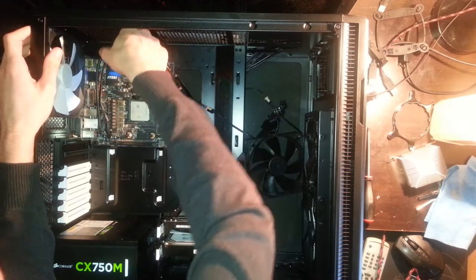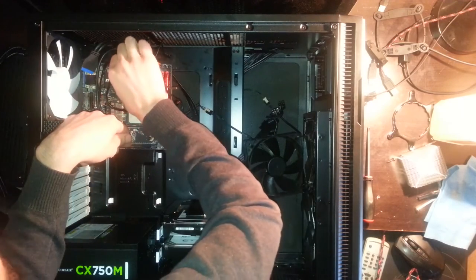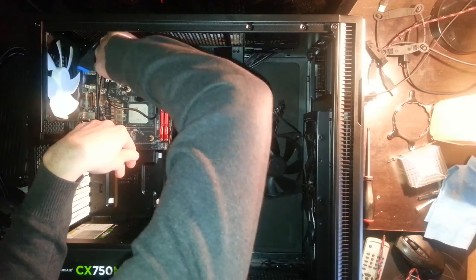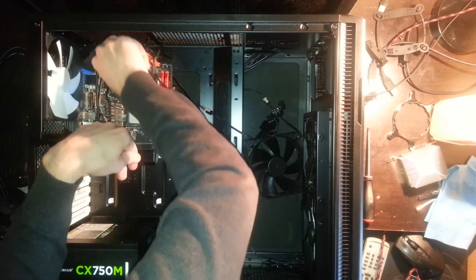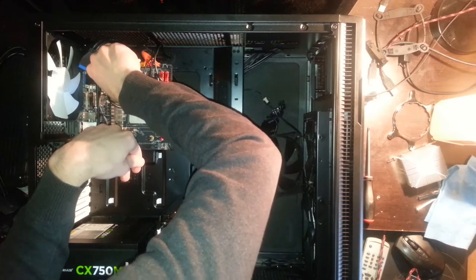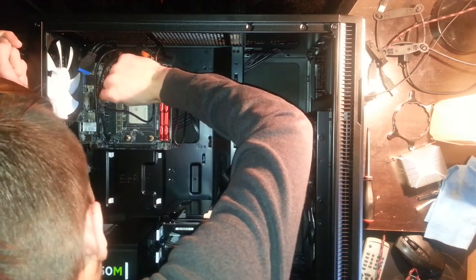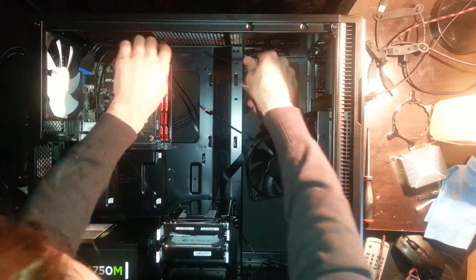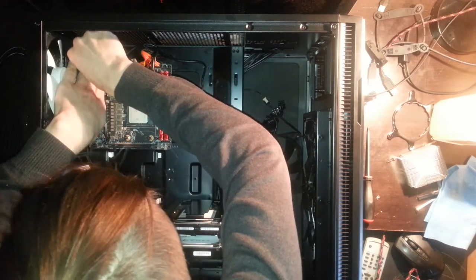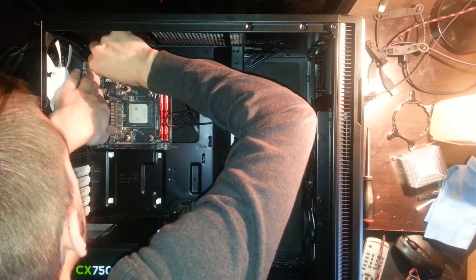That's why I told you there's not much cable management possible — everything is on the top: SATA cables, power cable. HD audio and CPU connector are on the bottom left. Now I connect all the SATA cables, and later I'll see a problem with that — if you disconnect SATA cables and reconnect them to the wrong side, you'll get a missing boot device error. I had it for about two minutes until I went into BIOS and changed the hard drive order. I also connected a fan hub to the CPU pump fan connector so I can control all fans with one button.